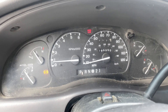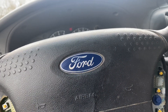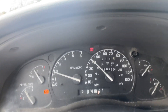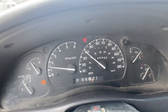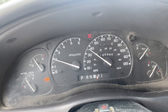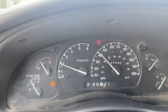I think I have bad U-joints on one of these shafts. We're going almost 35 miles per hour — I'm going to let off. Almost like I'm going over rumble strips, so I really think I've got some bad U-joints. Trying to go a little higher and let off.